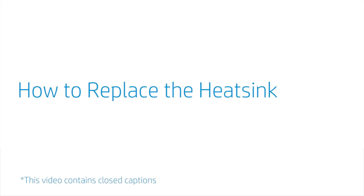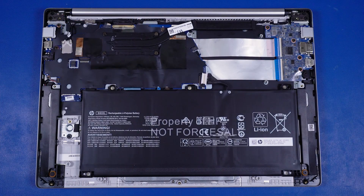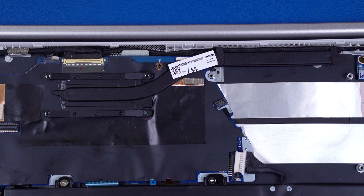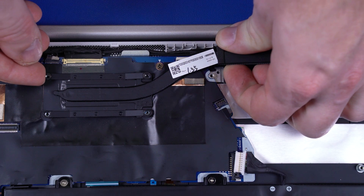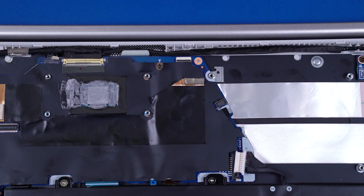How to Replace the Heatsink. Before you begin, remove the base enclosure and fan. Removal. Note, the heatsink has numbers adjacent to the following four screws. Remove the four P1 Phillips-head screws that secure the heatsink over the processor components in numerical order. Due to the adhesive quality of the thermal grease located between the heatsink and processor components, it may be necessary to move the heatsink from side to side to detach it from the motherboard. Carefully lift the heatsink off the motherboard and remove.